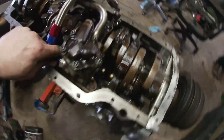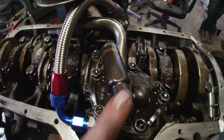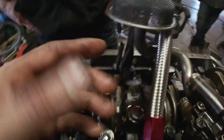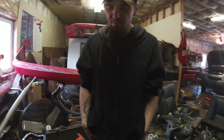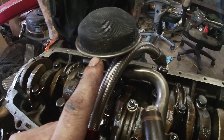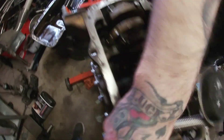The truck is the guinea pig — I'm doing a couple mods on the truck first in case something lights on fire, we don't want to burn the Supra. We shimmed the pump and did the oil mods. There's a tube inside the pump that extends past a certain point so it can scavenge for oil — if that's gone it won't scavenge properly. We'll probably address that later.